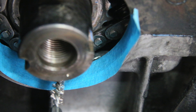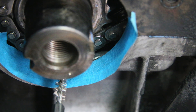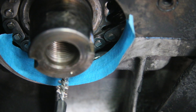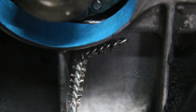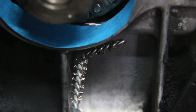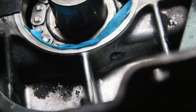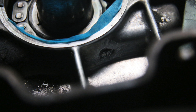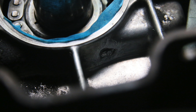Look at how I had to work that down in there. I'm using masking tape here to prevent any scratching of the lip that the crank seal sits on — don't scratch or damage that or you could have a leak through that area. I roughed up both the top side and the bottom side of the hole with a very heavy, tight-wound steel brush, and then got in there with a Scotch-Brite pad and roughed up the surrounding area.